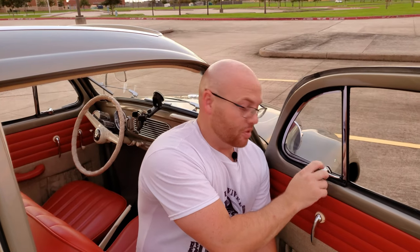Over here, you got your vent window, right? There's a vent window lock that you guys can buy that'll lock out right here on both sides of the vent window so nobody can break in there. On the older cars, like mine, this one works really good. You're not gonna be able to get into it, so it's not such a big deal. But on your later models with the bigger round button here, those are pretty easy and they wear out. These ones wear out too, these little triggers. They wear out and people can pop those up and break in no problem.